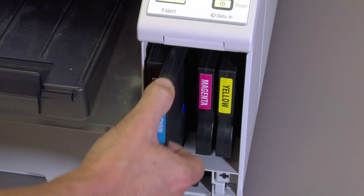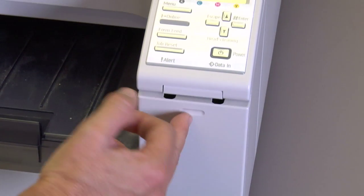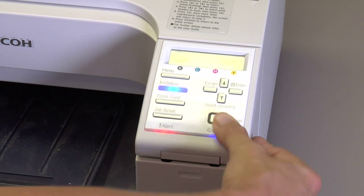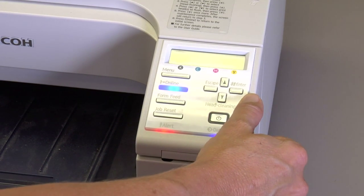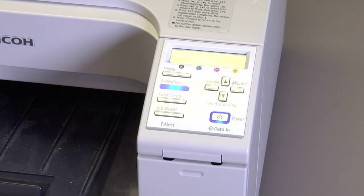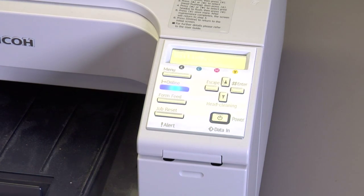So we're moving to the cyan — reseat, close the door, power back on. What we hope to accomplish here is getting rid of the 990 error by continuing to prime the line, because you can't do anything else when you have this error.